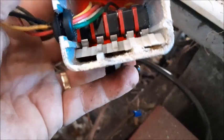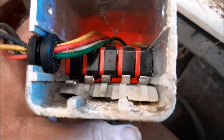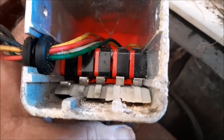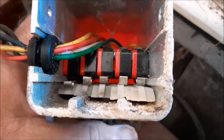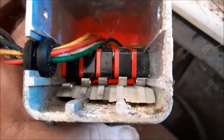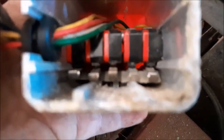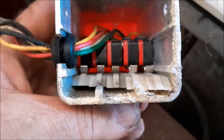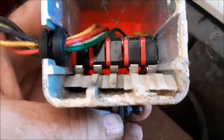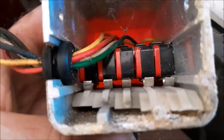The problem you could be having is that over time the bottom of that plastic slider ends up getting grooved when it's sliding back and forth on this aluminum box, which makes it drop down a little bit. That's why when we stuck our hand underneath it we were able to engage some of the speeds by just pushing up on the lever for the accelerator. In this case it could possibly be that your micro switches are still good, however the slider is kind of tilted down — it's actually gotten too worn on the bottom to engage the switches themselves.